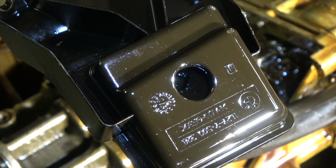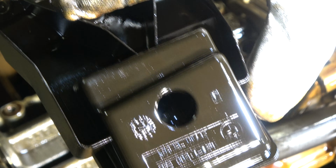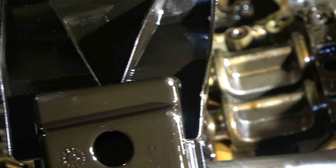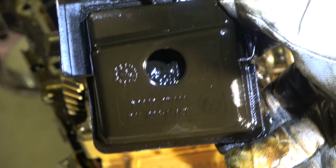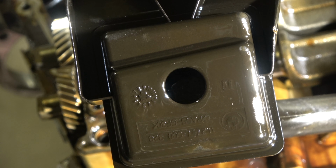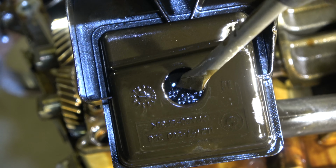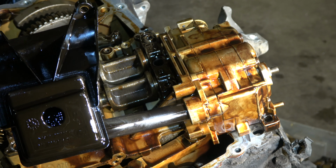Okay, and someone has even broken that. Okay, it is like a trick that when we look at this inner area, it means that this oil pump is broken. When we look, can I see? Yes, I believe that there is this filter element, and it is damaged. There is a hole. I take my screwdriver. Yes, I believe that this is now broken, because normally this filter is solid, and that tells me that this oil pump is possible to open.